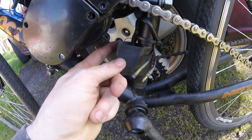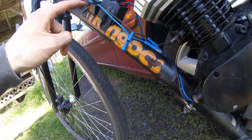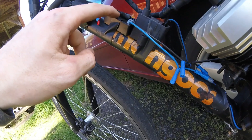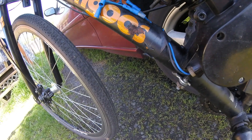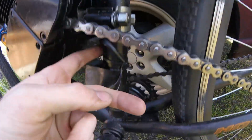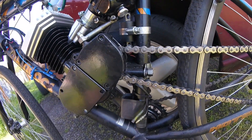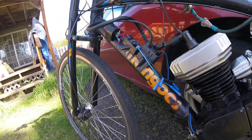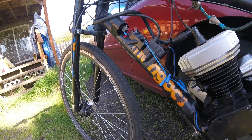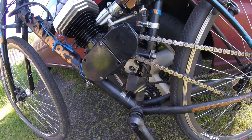On my bike I've got my PW80 CDI down here and my magneto wires going to the racing CDI — I could switch this quickly, it only takes a second. I have to run wires from here to this coil, which I already have a spark plug set up for. I like to change CDIs anytime I change a pipe to see which CDI runs the pipe best — pipes are picky, sometimes the ignition just needs to be specific.